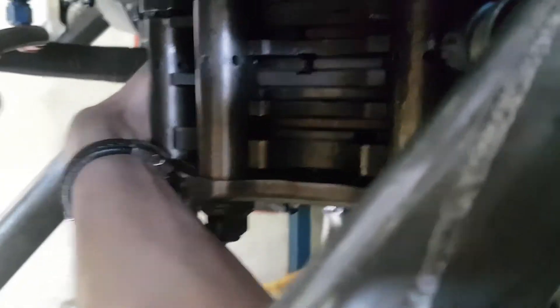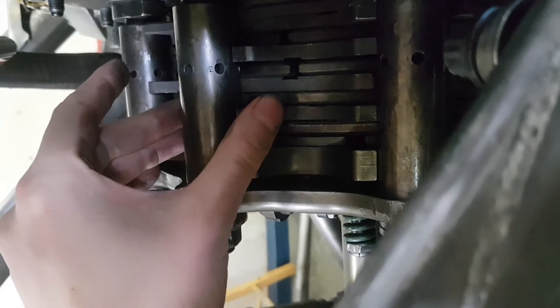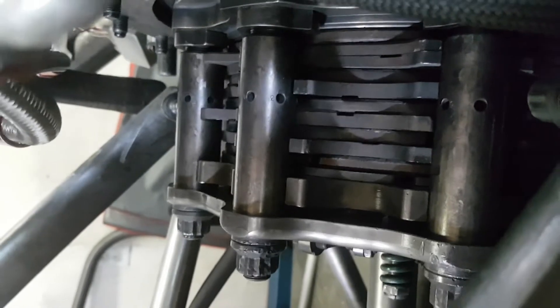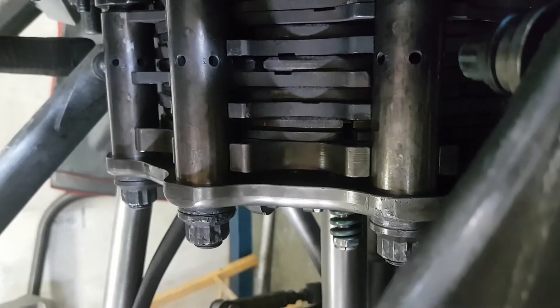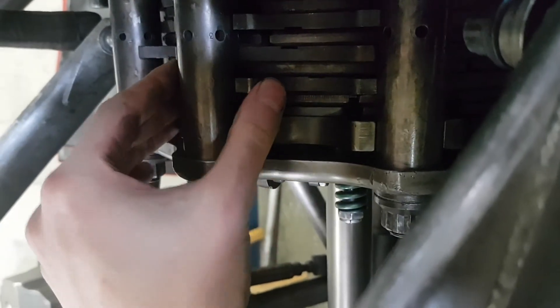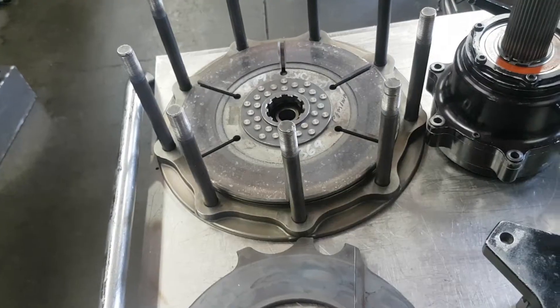The reason why there's such a noticeable clearance is that as everything in here is spinning, heat is slowly being built up. The floaters are wrapped around the flywheel and move with it, while the discs move on their own. You want to make sure you compensate for that heat so that the driver has control of the car, because once these start warming up too much the driver is getting into a dangerous spot where they're going to slowly lose control.